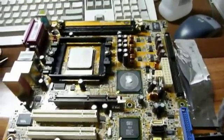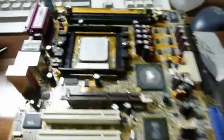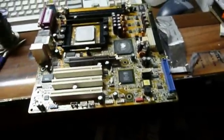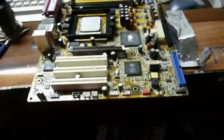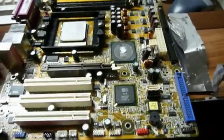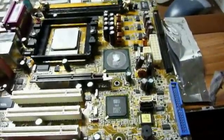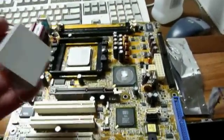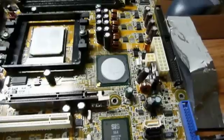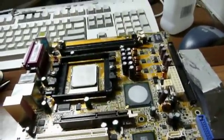I've got a little bit of a blob of heatsink compound there. When you're putting heatsink compound on something, the idea — as you can see from the microprocessor there — is to have a thin, even coating all over everything. The way I usually get this done, and some people might say it's not the best way, but it always seems to work fine for me, is to put a little bit of a blob in the middle and let the heatsink squish it out flat when I put it back on. The heatsink compound is now squished out onto the IC.